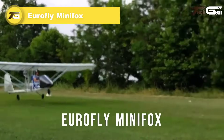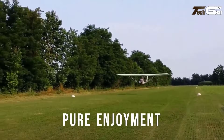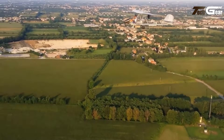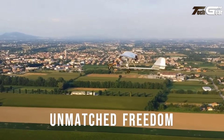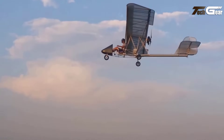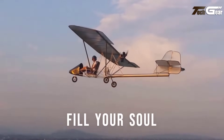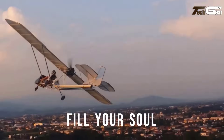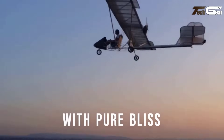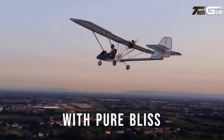The Eurofly Minifox is a versatile ultralight aircraft that impresses with its design and performance. Featuring a high strut-braced wing covered in polyant PX5 trilaminate sailcloth, it measures 6.10 meters in length and 8.65 meters in wingspan, with a wing surface area of 10.06 square meters. With an empty weight of 116 kilograms and a maximum takeoff weight of 230 kilograms, it reaches a maximum speed of 111 kilometers per hour, cruises at 90 kilometers per hour, and stalls at 45 kilometers per hour. Its climb rate of 2.5 meters per second, 70-meter takeoff run, and 75-meter landing distance ensure safe operations. A wing folding mechanism reduces width to 2.3 meters, and variants include the EVO speed and heavy versions, with the latter boosting takeoff weight to 350 kilograms.